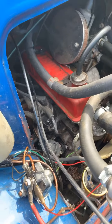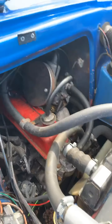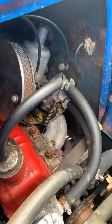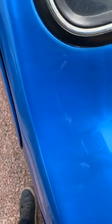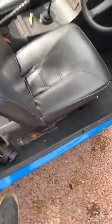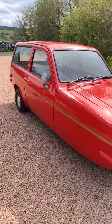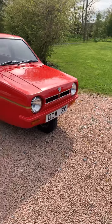Right, I'll show you an 850 engine. This car doesn't usually have mechanical problems apart from the beginning of every year when it somehow bursts all the fuel hoses. Here we go — this is the 850 Reliant engine. The difference is a red top rocker cover; the 750s had a beige one, and the 700s and 600s had a black cover. And of course the SU carburettor that replaced the Zenith — a much better carburettor, although I still like the feel of the Zenith in the 750s.